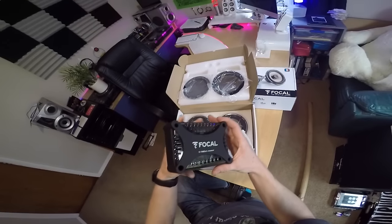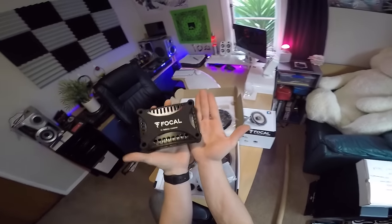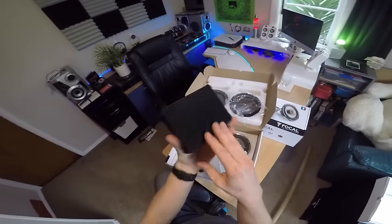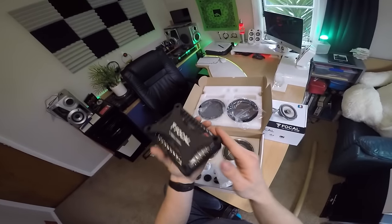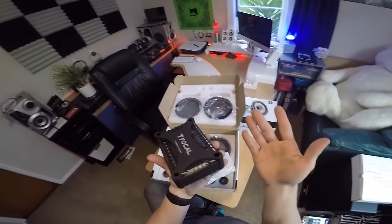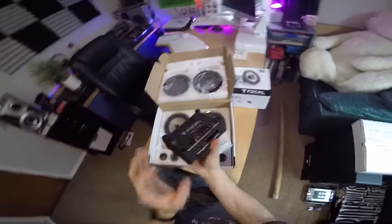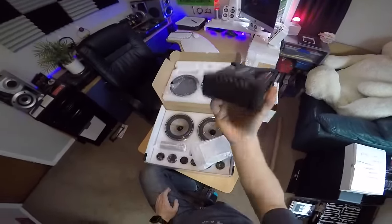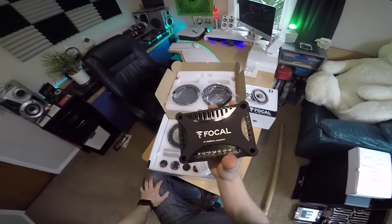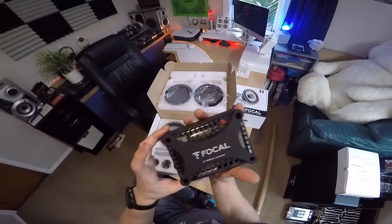The crossovers — let's have a look at them. We've got eight terminals along the front; I'll explain that in a minute. But basically the overall look of it — you can tell how big it is just by looking at my hands. They are a reasonable size, so I know where I'm going to put these in the car, but generally a lot of cars you have to find a good place for them. All the black that you see is like nice soft touch rubberised plastic. Obviously you don't need that on a crossover, but it's really nice to touch and feel and gives you confidence in the product — the fact that they're willing to put that sort of detail into something which doesn't really need to be aesthetically good looking since it often gets hidden. It says 12 to 18 dB octave crossover — I guess it says that because it is adjustable. I'll show you the switches inside in a minute.